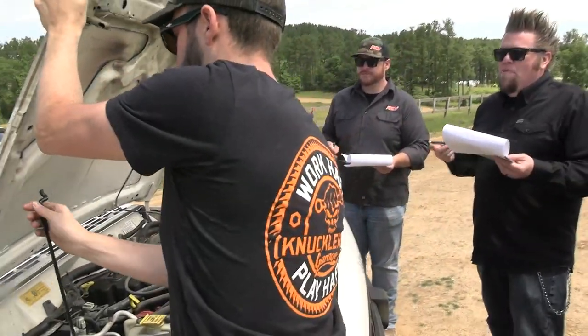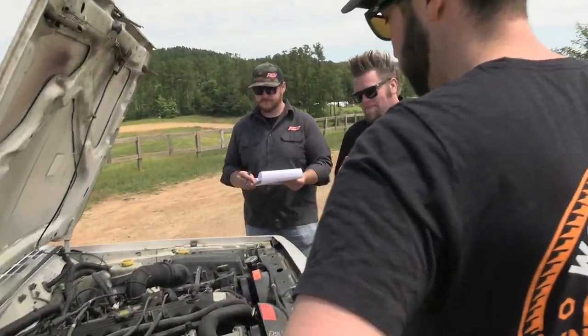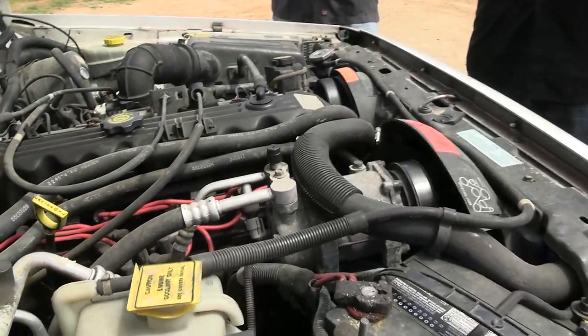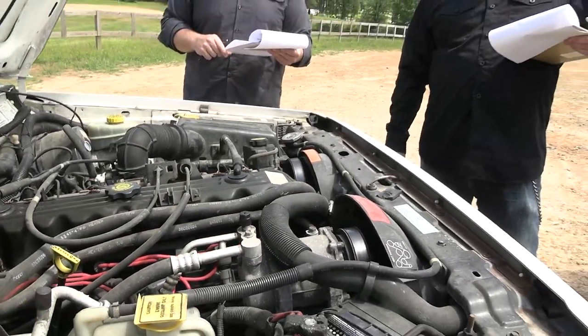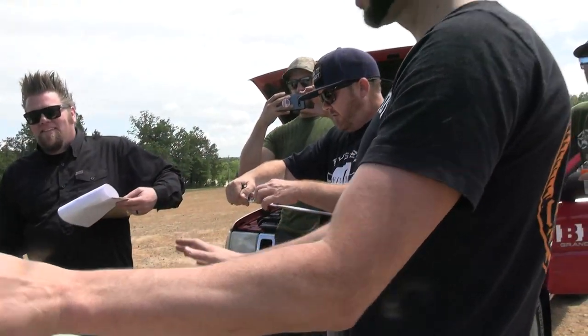What is this? This is a 1997 Jeep Cherokee XJ with the 4-liter. 97 is the year that came with the high pinion 30 front, and you could find them with the 8 1/4 rear. That's what this one has, and why I chose it. I like that. So you did some thinking on this. A bit of thinking, and I didn't do anything to this other than safety mods.